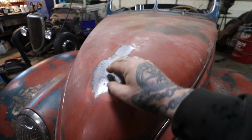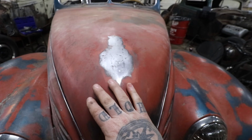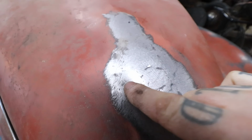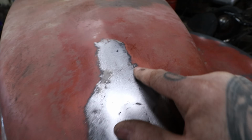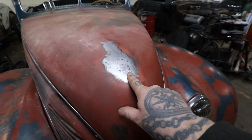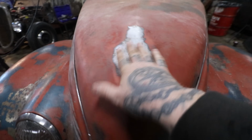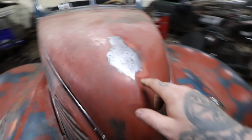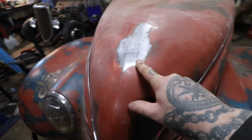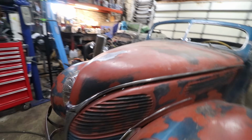So I started melting lead out, and it went way out into here, went up into there, and then I found all kinds of rough gouges, you can kind of see them in here. It looked like they had like 20 grit or something, or a big sander, and they went over this thing, and it was just rough as heck. But I used the planishing hammer after I welded everything up, made the best of it. There's definitely still some little pits in the weld and stuff. Used the slapper and hammer and dolly, and got the shape basically back. Pretty happy with it for now.